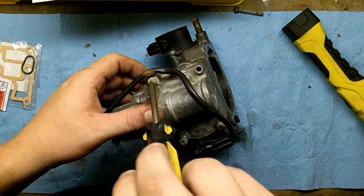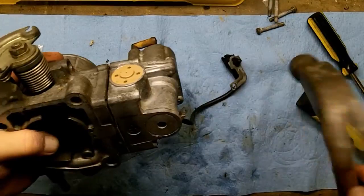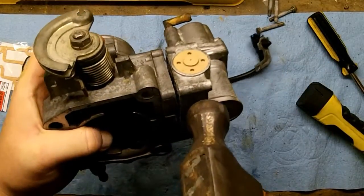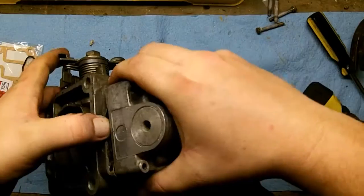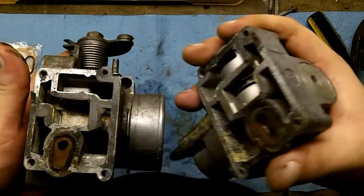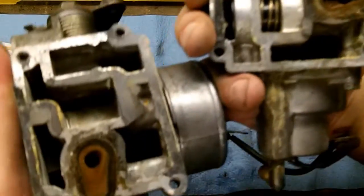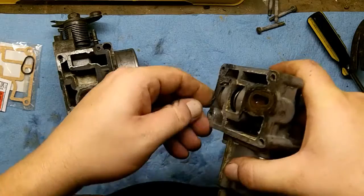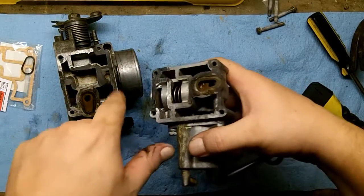There's got to be some other screw here that I'm missing — I was just being too gentle with it. Just take a hammer and whack it right there. It comes right apart. There are obvious signs of leakage around that gasket — it was leaking out the front, as it should have been. Make sure you don't get any of this junk down inside your IAC on either side, because it's going to get stuck in an air channel and that's basically an obstruction.